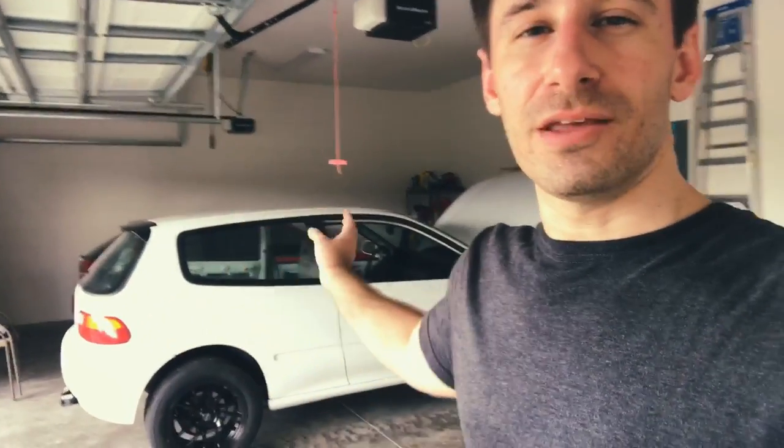So you put the little nozzle on for the tube. You break the 10 millimeter bolt free, you'll see some fluid going. You go in and press the pedal. I pressed it 5 times, and then I would go and check the rear. I would see if bubbles were coming out. I would see if the fluid had changed color.